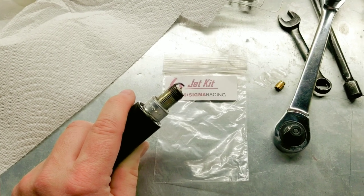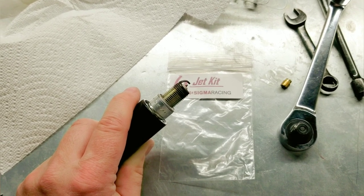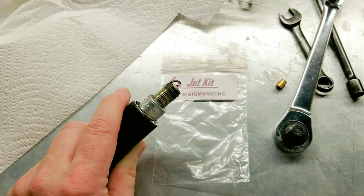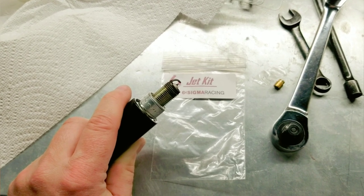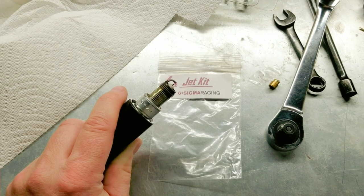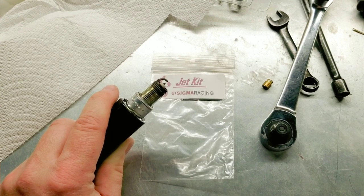This engine has never run better. I know when I get up to altitude — 7000 feet where we camp — it's really going to run better, because before it was just puking fuel and the plug was black as the ace of spades. In my previous maintenance video on this generator you can see when I pulled that plug it was pitch black — completely fouled out — but it still fired because of the iridium. Now after running the number 68 jet at full tilt for 20 minutes, the plug is completely cleaned up, the right color, not overly white. Number 68 is where it's at for me at 1100-foot altitude here in Phoenix. Thanks for watching, and subscribe if you like my videos.